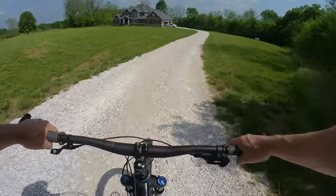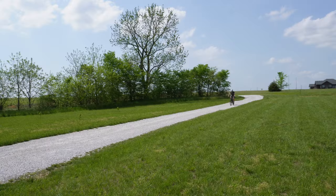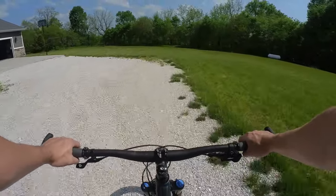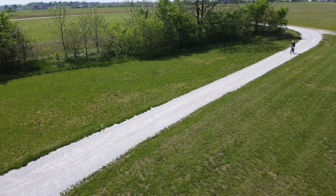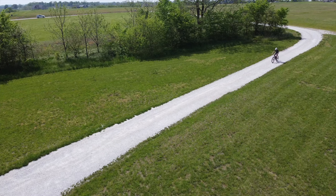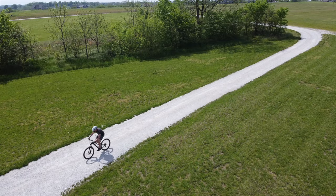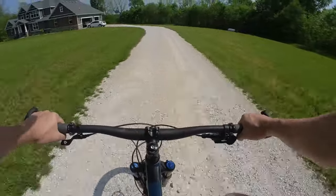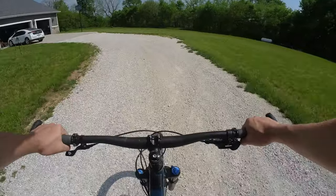Now we can go ahead and get up to speed — remember we're going to focus on the front brake first. Now that we're up to speed, apply some pressure, then get down to walking speed and let go. Let's repeat this 20 times. You'll start to feel the brakes get stronger and stronger as you go. Oh yeah, these are really bedding in now.